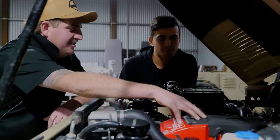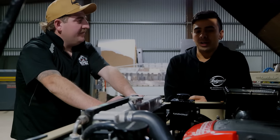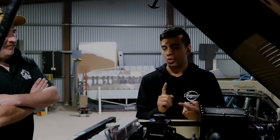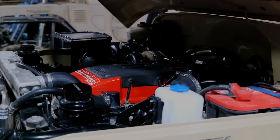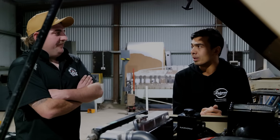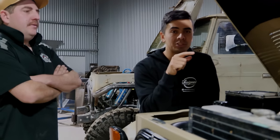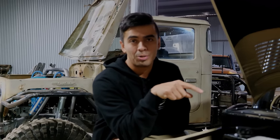What about this motor? It's a red-top — it's an FG turbo motor. I bought it from a wreck essentially as a front-cut, everything pulled straight out of the car. I've left it pretty much stock: oil pump gears, valve springs, bigger injectors — RaceWorks fuel rail and RaceWorks injectors. It's pushing 300 kilowatts at the hub, 600 Newton-metres through an auto. The car weighed about 2,400kg without the canopy. Same as Paulie, I've opted for a small turbo for responsiveness, with a log-style manifold. I'm not there to chase numbers — I just want it to be drivable.